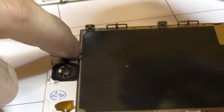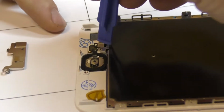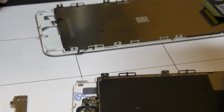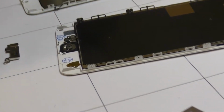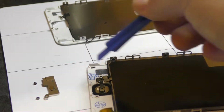Okay. Oh, there, bud. Yeah, that wasn't very elegant. You just got to be super careful. We don't want to break it, but if we break this side of that connector, we can take this plate off and reuse this connector. This will all come off, but you have to be super fast and clean about it, because anything that gets under that is going to show up through the display. But these backs are removable and you can transfer them to another phone. Alright, so now we want to put our plate on here.